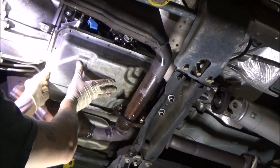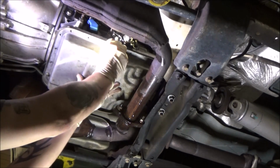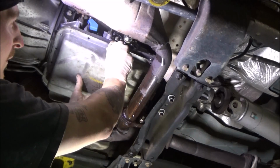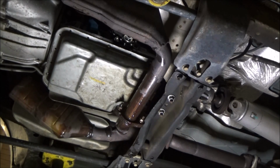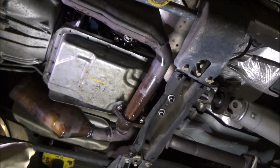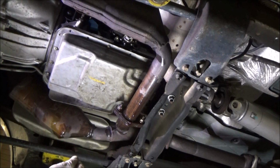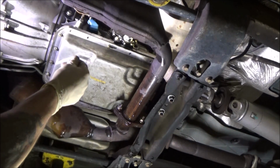Let me get this gasket lined up. Just get a few of these bolts started by hand. Make sure my gasket is lined up, obviously. Wonderful. Okay, now that I have a few bolts in, I'm just going to start the rest using a little DeWalt drill. Got it on a real low clutch setting. These bolts are tapered, so there's really not a whole lot of risk of cross-threading here. And I just dropped one again.